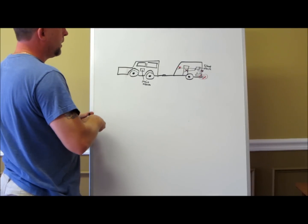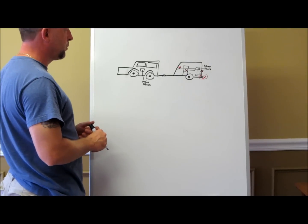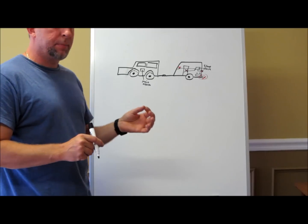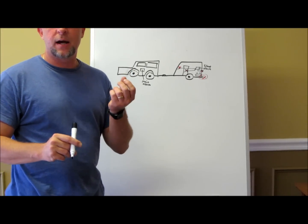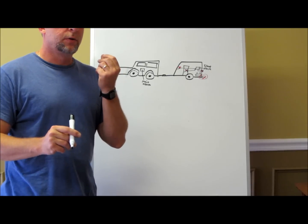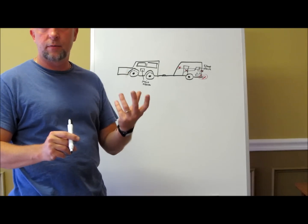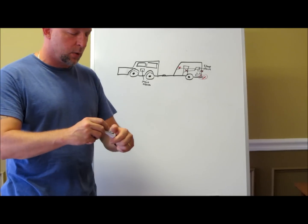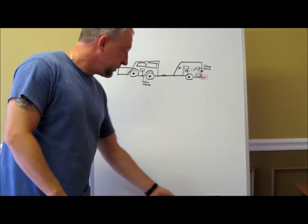All that stuff is on our site. To recap the product codes: mercury switches are the AU46, contact switches are the AU45, the glass-break slash mic audio sensor is the AU-85TN, and the dual-zone proximity sensor is the AU-94TM. Grab what you need, get your goodies, and get the system working. If I talked too fast or didn't cover something you're interested in, let me know. Whether you're Casey or anyone watching with a similar trailer security situation, I'm here to help every one of you. Happy wiring!